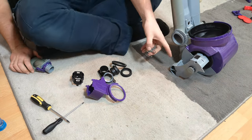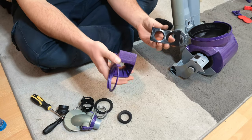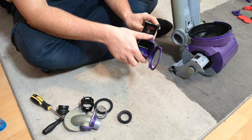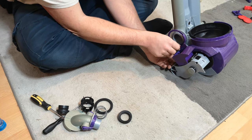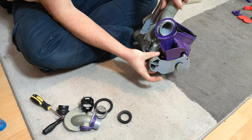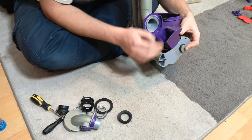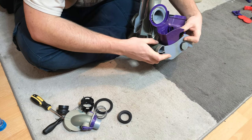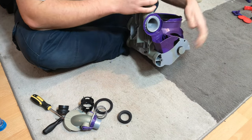Now go to the bottom to assemble the changeover valve. Out of all the pieces, you need: the big clips go at the back, the little clips go at the front. Slide the carrier onto the part, manipulate it in loosely, and make sure the clips are pushed right back into where they go. Eventually the planets will align and it will all literally drop together with a snap.